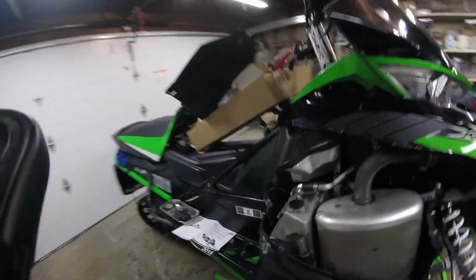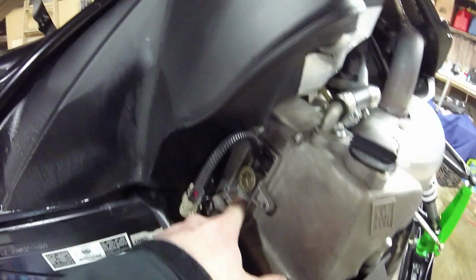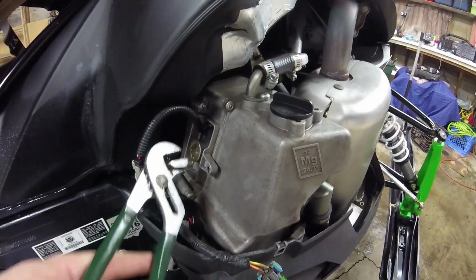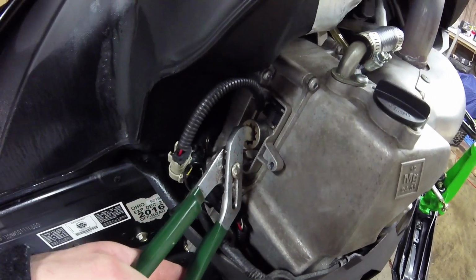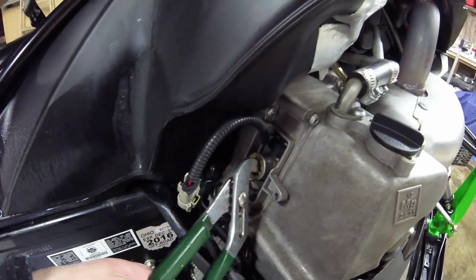Alright, so the way that I found this is easiest to do, this is before the upgrade on the actual actuator and extension setup itself, because there is an upgraded part number for this that adds a stop here, and it's supposed to keep your reverse gears a little safer than what they are now. But anyhow, you grab a hold of it, try not to mar up the threads inside of it, and you just pull. Well, actually, before you pull, make sure that it's turned all the way counterclockwise until it won't go anymore, and then just grab a hold of it and pull.